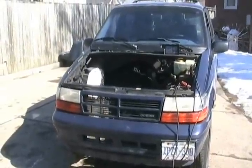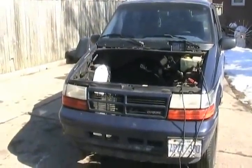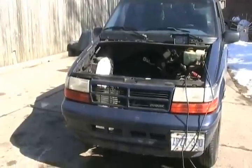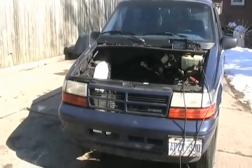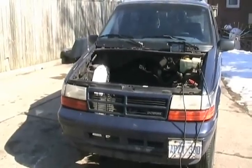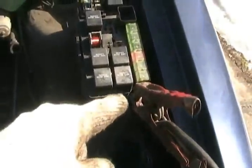Now since this is a gas engine plumbed vehicle, I have to first purge the fuel lines of the gasoline in them to get the diesel coming through that I have in the tank now, so I don't get gasoline into my diesel injector pump. Since I have all the battery wires removed, I've got the battery thrown in with a positive cable running to the B-plus bus on the fuse box.